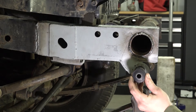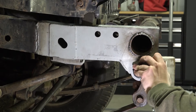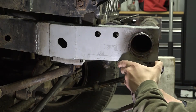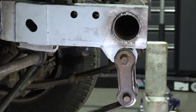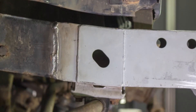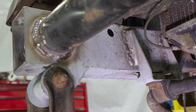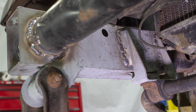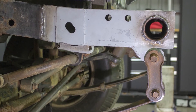Step 9. Begin reassembling your vehicle by installing a new front shackle mount bushing into the part according to the manufacturer's instructions. Re-secure your upper leaf spring shackle and bolt using two 19mm sockets. Re-secure the lower shackle bolt. Re-install your bumper and frame covers. Re-install your wheel well liners and wheels. Re-connect your battery and you're done.